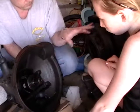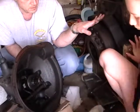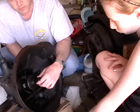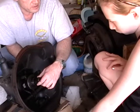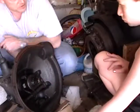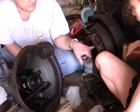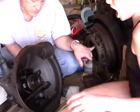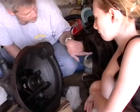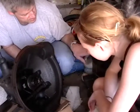Unless you know what you're doing, if the engine's spinning, then it's hard to shift the gears, right? Because the back wheel's not moving at all. If you stopped at a stop sign, this thing's spinning, but this thing's not. Or at least the wheels aren't turning. So how do you get it into gear? You have to make the engine seem to stop spinning. So when you press this out, this throwout bearing comes out like this and it presses right here on these tangs. These little metal pieces here.